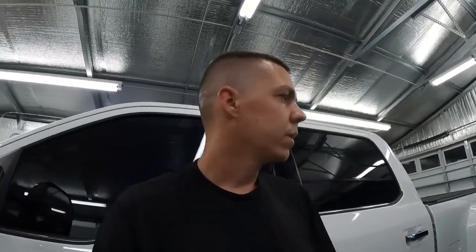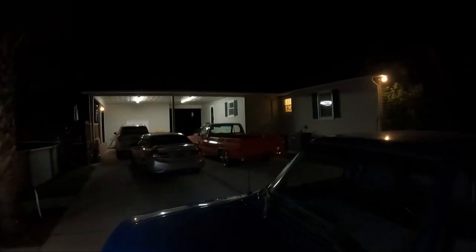I feel it's pretty good — it's probably got to settle a little bit. The lowering springs are considerably shorter than the stock ones. Anyway, let's get the wheels on and check right back. We got it done, got it on the ground, got it outside. We couldn't get a good picture inside. We haven't drove it yet, so we just let it off the jack — it's probably gonna settle a little more. You know, you set it down off the jacks and everybody's like the front's so much higher than the back — well it's got to settle, you have to drive around the block a few times and it'll level out.